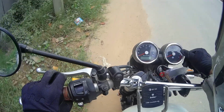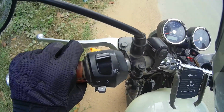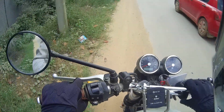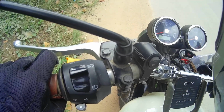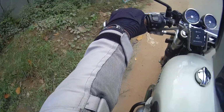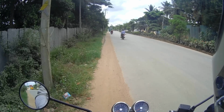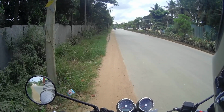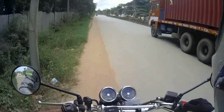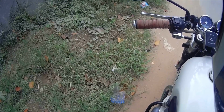And mine is mounted on this additional riser, but yeah, looks like it's actually the riser that's bent, the original riser. So as of now, it looks like it's just the original Royal Enfield riser that I need to replace. Nothing seems to be wrong with the handlebar itself or my add-on riser. I just got the replacement riser today and I'll be trying it out tomorrow to see if that fixes it and completely aligns the handlebar.